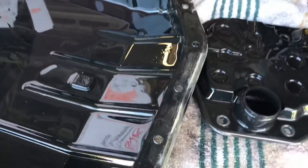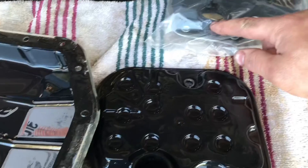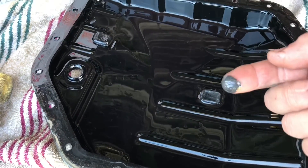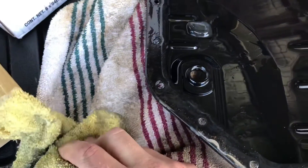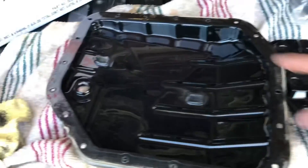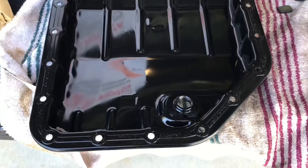Here's our pan and our old filter. Before you swap the filter, make sure they actually match — the holes line up and the part that goes into the transmission is the same, and it has the o-ring on it. What I'm going to do is clean out the pan. There's a magnet right here that picks up clutch material and wear debris. I'll clean those up, get the old gasket off, then install the new filter in reverse order.